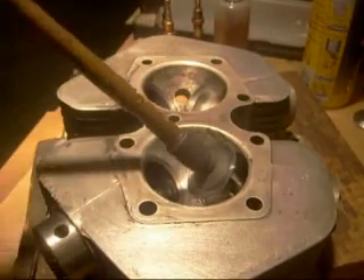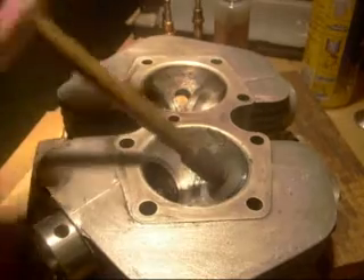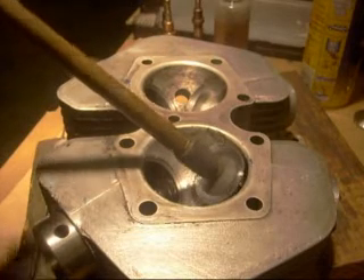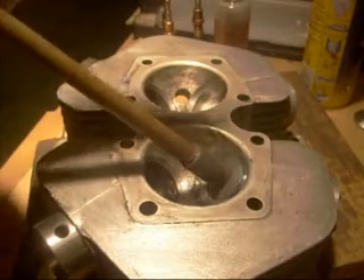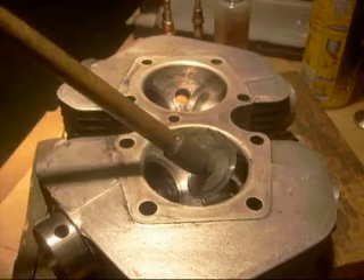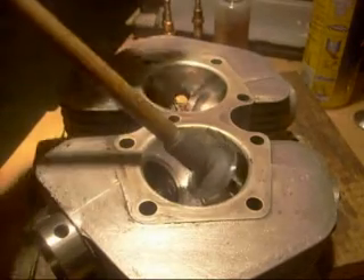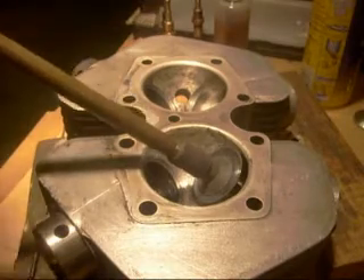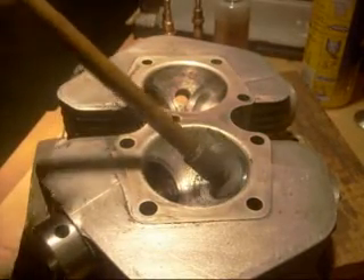I should be on the last of the coarse now. I'll double check with a blue again. You might have noticed I'm spinning the valve nearly all the way around as I'm taking a lot off. There's no harm in doing that, but you should do it in about thirds — turn it a third, back, back a half, third — that's the rhythm you should have. The reason you don't spin the valve loads around is the grinding paste gathers up into the little troughs it makes and just ends up making scouring marks around the seat, which you don't want. You want them perfectly smooth.